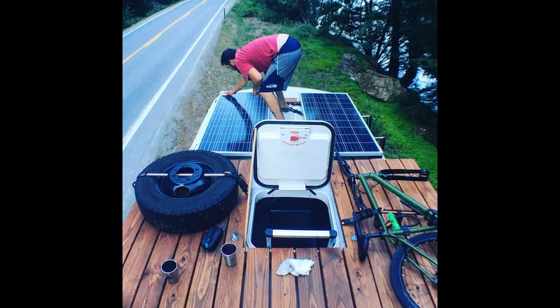They claim to have done the math and that it would be fine, but in my mind it would be wiser to put such a huge weight directly over the axle, or to simply have less water on board. I've also heard stories about a beautifully built-out bus that, after conversion, weighs in at 36 tons, and they can only go about 4 miles per hour up hills, if they make it at all. One final example of overweighting a vehicle is some friends of ours who were living in a van but had so much weight on the rear axle — they didn't have dualies — that the axle actually bent and the tires slanted in towards the center of the van, resulting in an expensive breakdown and repair. Check your weight ratings, distribute weight wisely, be practical about the weight of all your construction components, and be sure to keep in mind how much power your engine has to ensure you can still drive the bus after you've converted it.